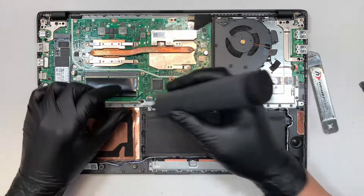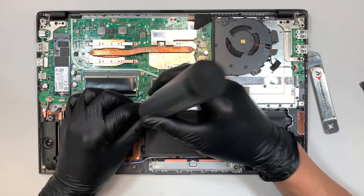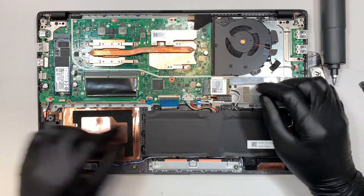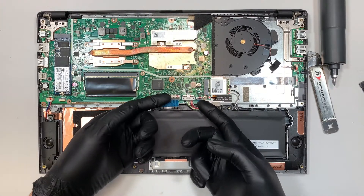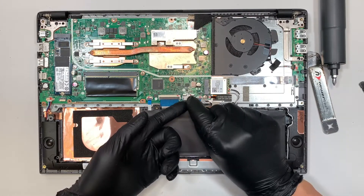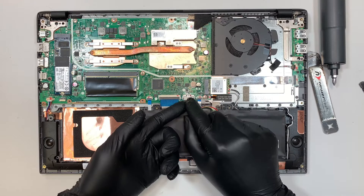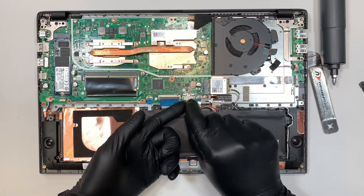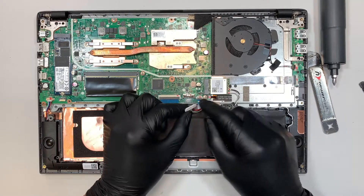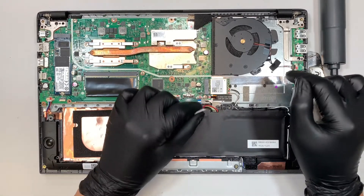Let's go ahead and remove the battery. Once you remove the bracket, the battery slides out. You need to slide the connector in this metal piece away from you. To insert, you push it down — it's a clip-on, so you clip onto the connector. To remove it, you push it away in that direction, then lift it up. The connector is not a pull connector; it's kind of like Lego — it snaps on top, and the clipper holds it down to the wire.